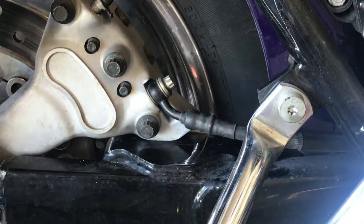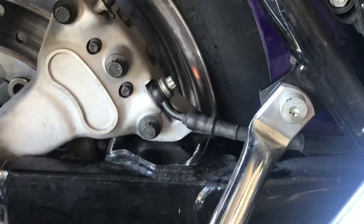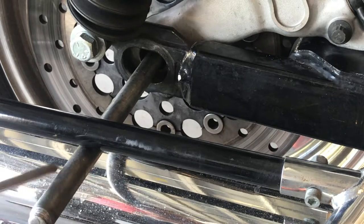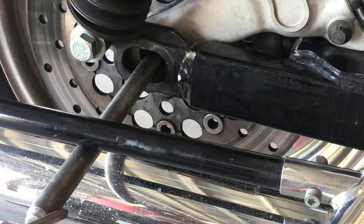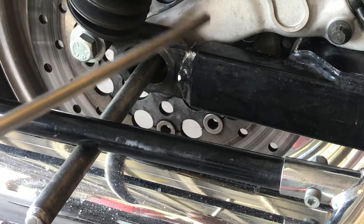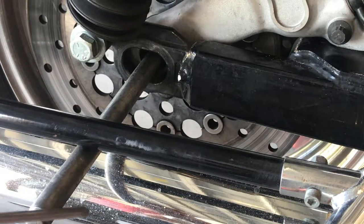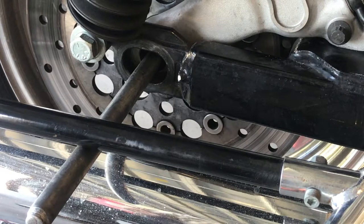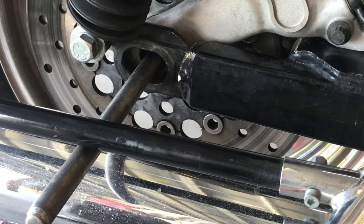And this side's all lined up and put together. Now with this half inch steel rod in place. Now if you were trying to do this with the 1 inch axle, you don't got much wiggle room. I believe this just makes the job a lot easier. You ain't beating yourself up to get this caliper in place. You ain't beating yourself up to get the bushing on the other side. Because now we gotta go to the other side and put the last spacer in.